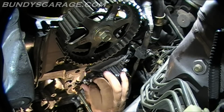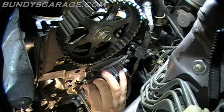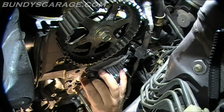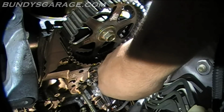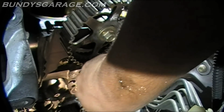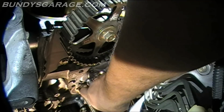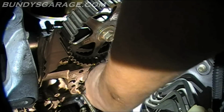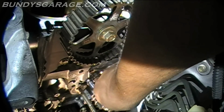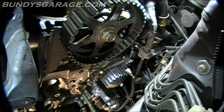Torque spec is like 8.5 foot-pounds. I'm going to run it down to 10. That's the lowest my torque wrench goes to. Let's go ahead and start tightening these down by hand a little bit. Just going to snug them up. Kind of going in a star pattern. Okay, and then get this top one right here.